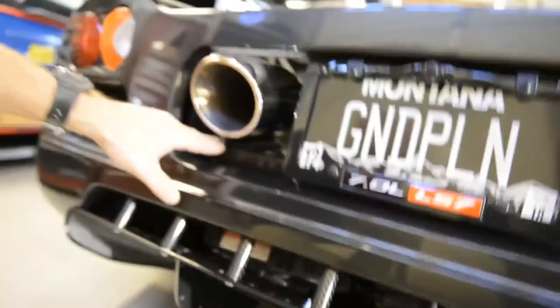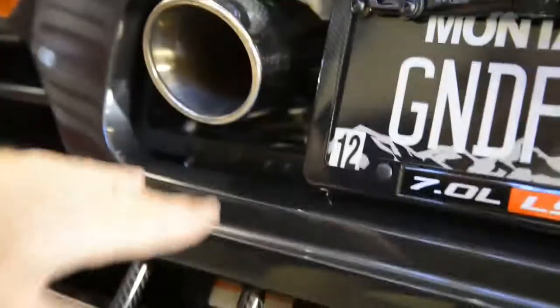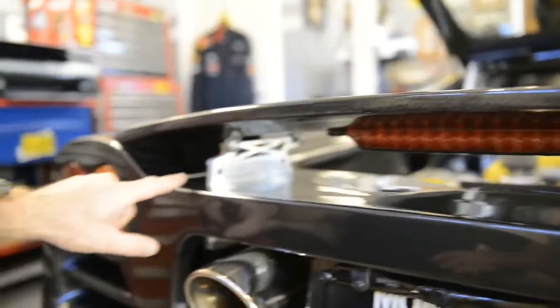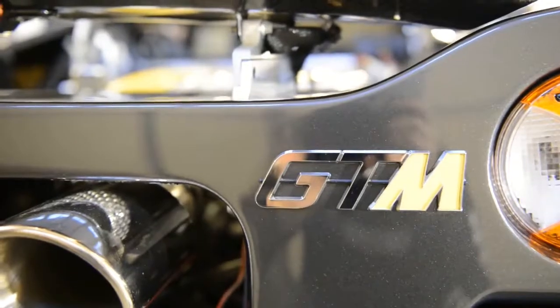Here you can see the wing mount — all water jet-cut aluminum. It goes all the way down; these big plates bolt to the frame, so it doesn't touch the car body. When you position the body and do all the work, you've got to have these coming up at exactly the right place. It's adjustable, but if you look at the fit, there's like no room. It turned out perfect — no gaps, and I painted the car without chipping the paint getting those mounts through the body.